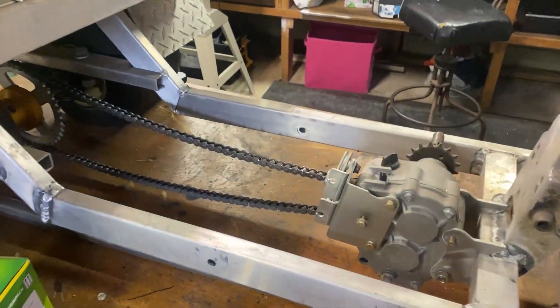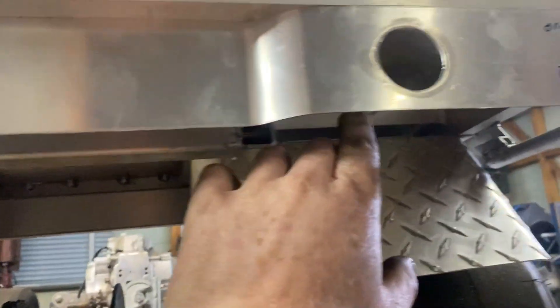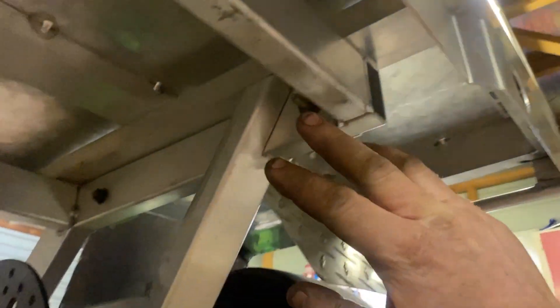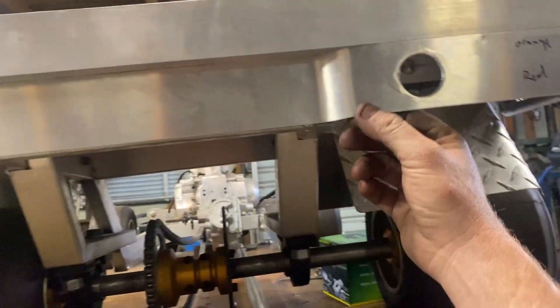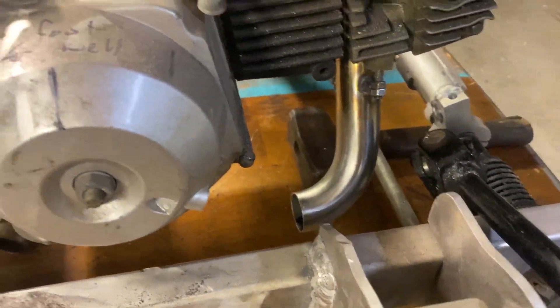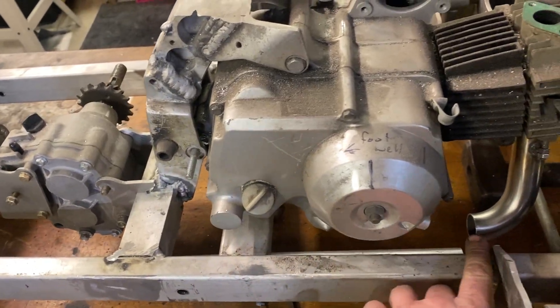So we're clearing all the cabin here — it's going to run straight along here, there's nothing under here. Then 90 degrees up under the tray, we'll run it through here and then T-piece it off and come out. Like I said, it's for the kids, it doesn't have to be crucial. We could run it from through here and then drop it down just so you don't see it under the back tray guard. On the real one it actually runs up through here. So we've got the header on, cut that back a bit, and we'll come back to the engine mount cross member here — it is actually a little bit lower than the plane of the exhaust how that's coming out.